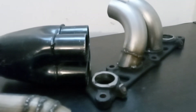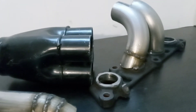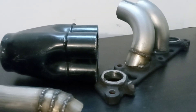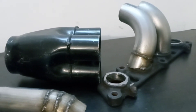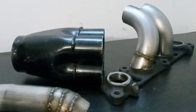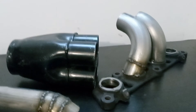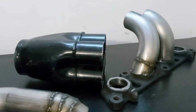I've got 73 subscribers now, so I wanted to give you guys something and let you know I'm still working on the project. After the header I could start it, but I'm not going to — I want to put newer rollers on it, new valve seals, and clean the intake manifold. Just do things a little better. I'm not super OCD, but it's just peace of mind. Seals are cheap, I can do the work, why not.